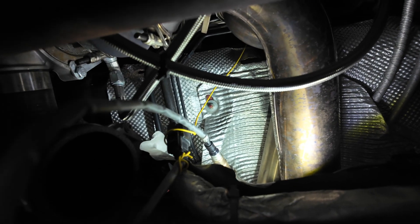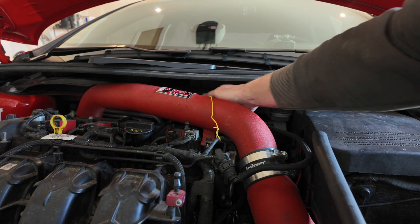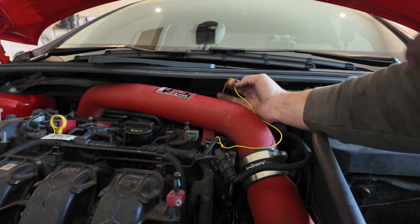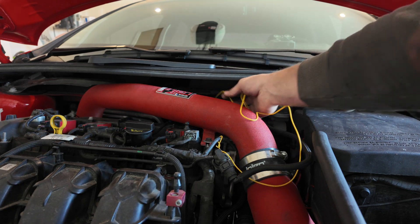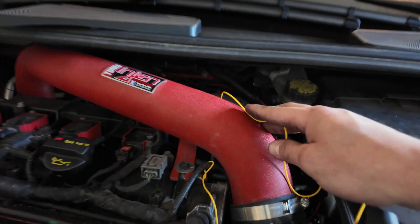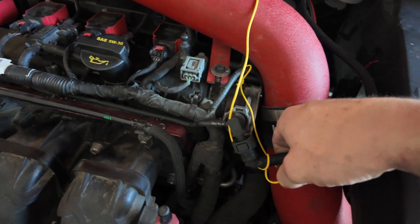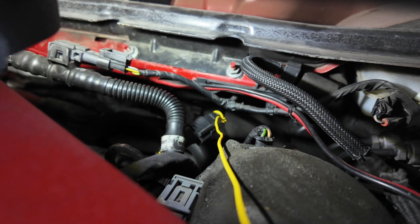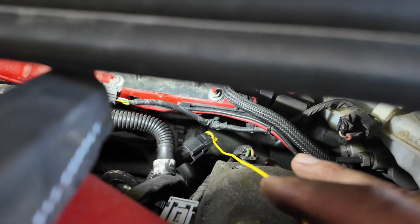As you can see, I have this O2 sensor connected to that wire. I'll just pull it from the top and it will slide up past those other tubes right next to the firewall. Just like that, you can see the connection right there. I'm going to try and tie it up here. I just want to make sure I have it connected properly — I just connected it, heard the click — so I can disconnect this wire and the O2 sensor will not fall back down.